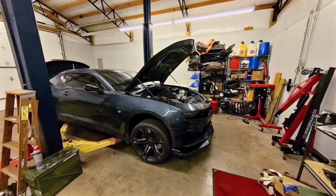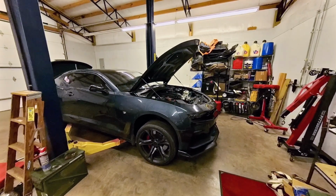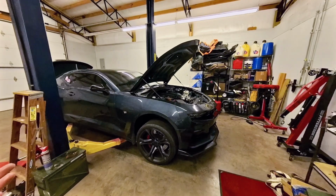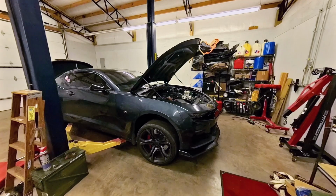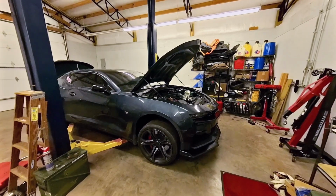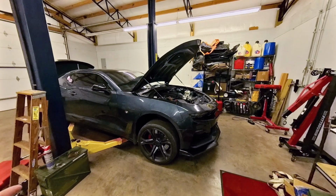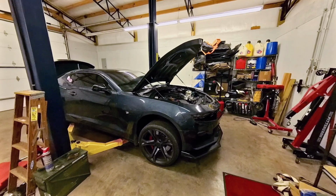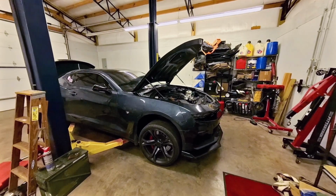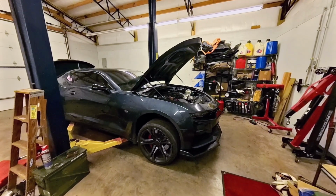At one point I had a belt issue with my pulleys and my tensioner, and that's all been rebuilt. I went from an 8-rib to a 10-rib system. Right before I did that, I kept throwing belts. One time I threw a belt, it took out my oil pump sensor, just the connector. The connector was ripped out of the other part of the connection. It didn't destroy the oil pump, but it made it so it was no longer controlling oil.